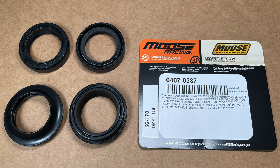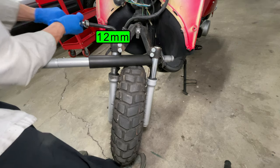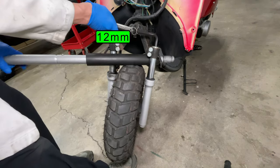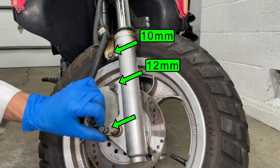They could be a different diameter on your scooter. The top cap takes a 12 millimeter allen key but the bolt is stuck. I added a wrench for leverage and held the fork with a jack handle to break it loose.